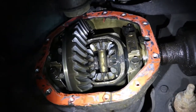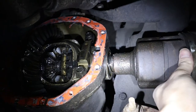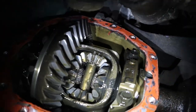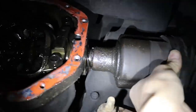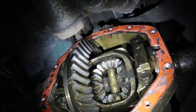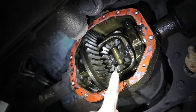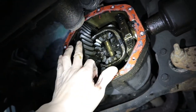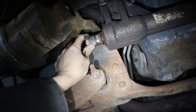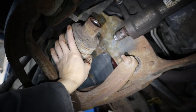It's just regular wear and tear due to the mileage of the vehicle. When I shake the shaft on the driver's side there's a little bit of play as well, but it's not bad — just the side gear inside has some play. So it's not the actual shaft that's the problem there. This shaft needs to be removed to replace the seals, but the gear assembly is good. So we just need new fluid, a new intermediate shaft, new seals, and the CV axle shaft on the passenger side.